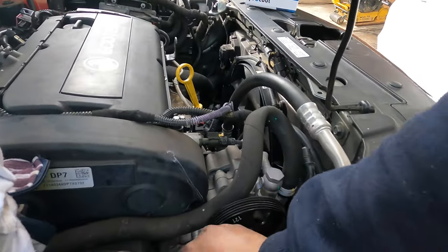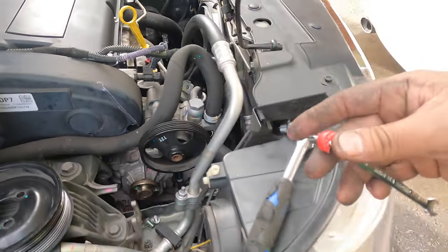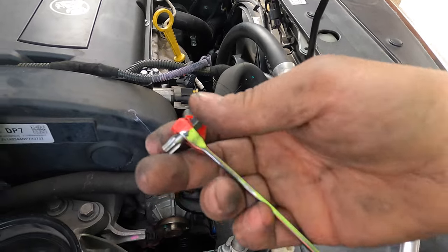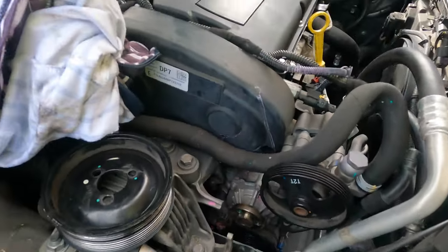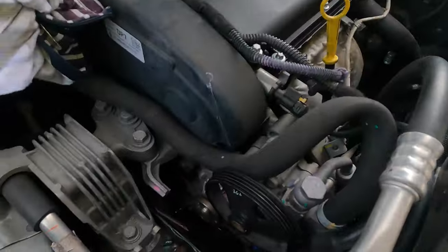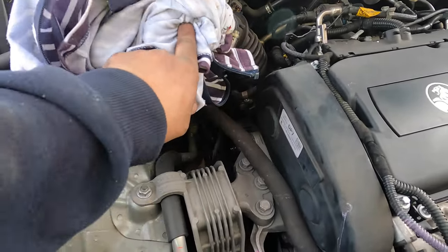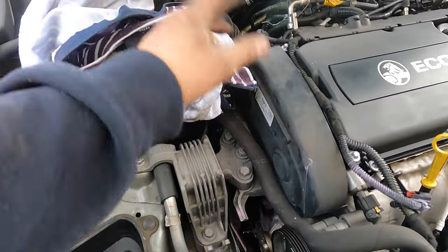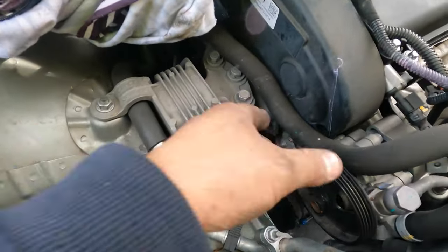But before doing the belt tensioner you need to lift the belt on so it grips on the pulleys. You can loosen all this first before you release the tensioner. That's the tools I used to take it out - you have to put it back exactly the same way. Use the Torx 40 and lift the bolt here. Don't lose it. Cover the air intake because there's too much work around here - don't want any dust flying in there or you're in small trouble.